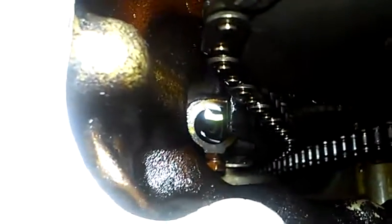That's because there's a spring down there on the passenger side of the chain that has a tensioner on there that pushes out a piston up against that tensioner onto the chain. Well, that spring's not long enough.